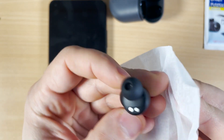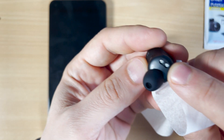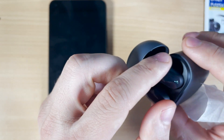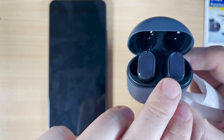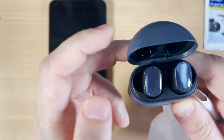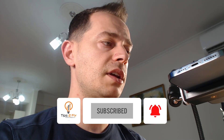If it still doesn't work, then it may be a firmware problem. Also, the charging connectivity pins on the bottom are very important — if you don't clean them and they are dirty, you won't be able to charge the buds properly and one bud may be more charged than the other. Make sure to clean these pins inside everything. These are the methods to fix the Redmi Buds 3 Pro. If you have any other problem, write a comment. God bless you, see you on the next video tutorial.